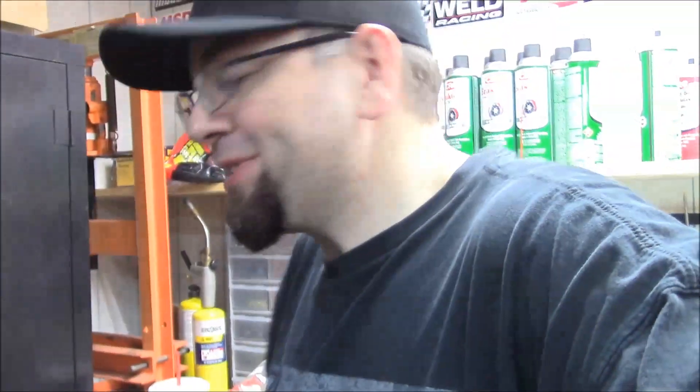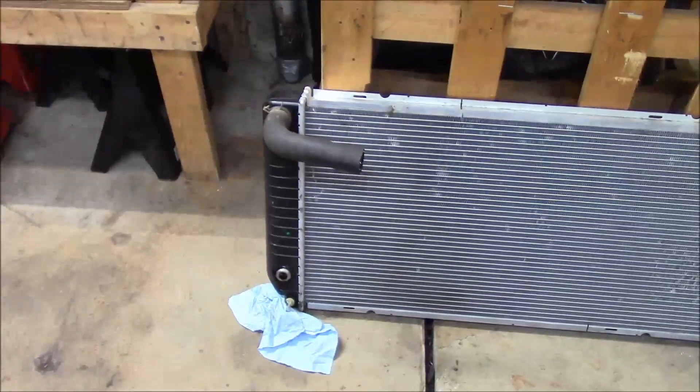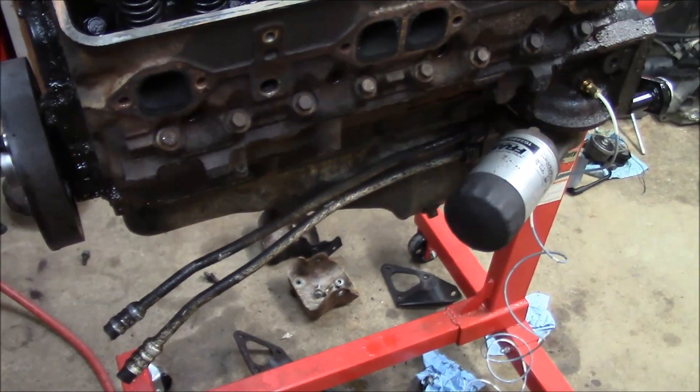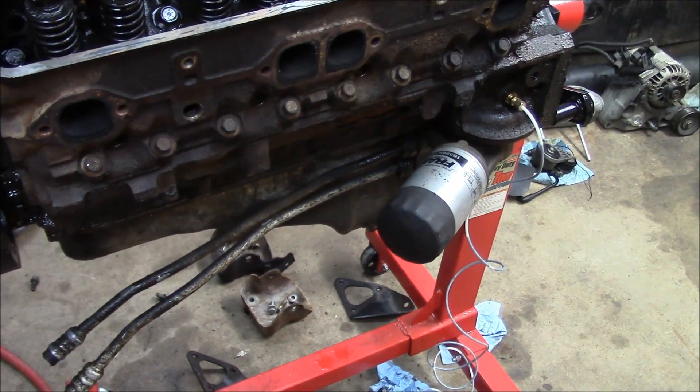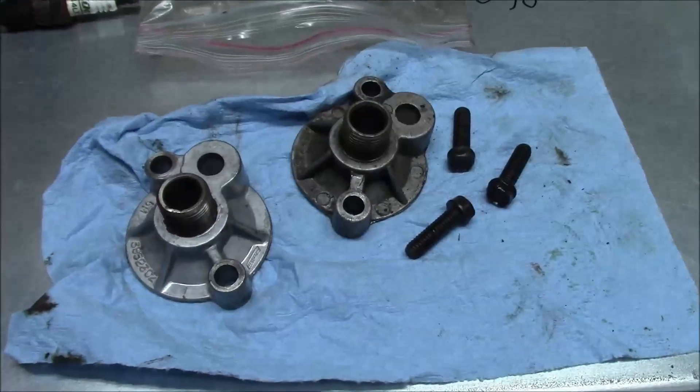Refueled and ready to go. I plan on doing a few different things to try and figure out what's wrong with the oil pressure — kind of a before-and-after comparison. But while removing the engine I kind of screwed that up. This engine has an oil cooler that feeds into the radiator, and when I unhooked those lines I thought they were power steering cooling lines, so I didn't account for them and I mangled them. I can't loop them without leaking, and I'm not buying new parts just for a test, so I'm going to skip that step and go right to installing one of the older oil filter adapters, then prime it and see if the pressure goes up.